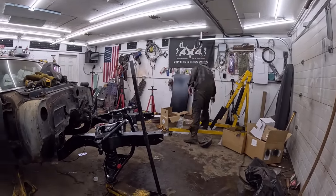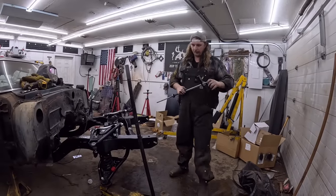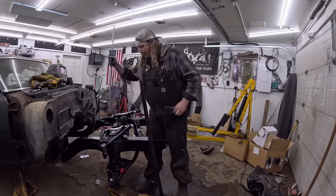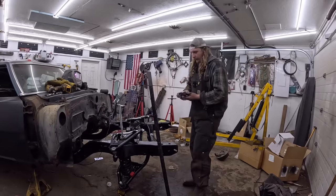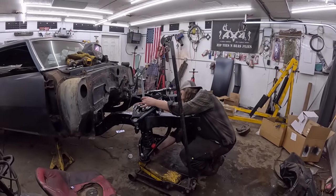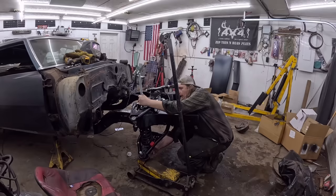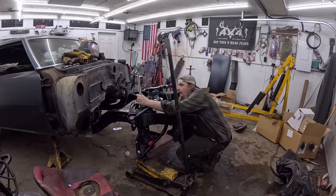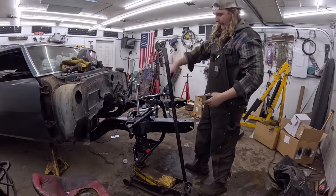We don't have that option, but we do have this, the Danimatic. So I'm gonna jam this sucker through, and this will act as a little safety. Ultimately, we're gonna run out of jacking tension anyways, but we just got her in there. So if we put this on, like so, really mess up the paint with it. So we do here. This will now eliminate the spring from being able to explode out and rip our faces off. So now we're safe. No matter what happens, if the spring decides to pop out or anything, we're gonna clamp it by threading it instead of using the weight.